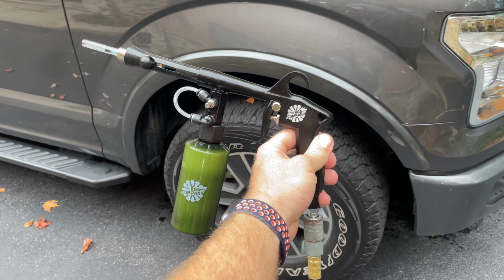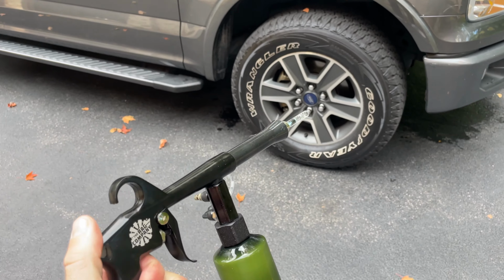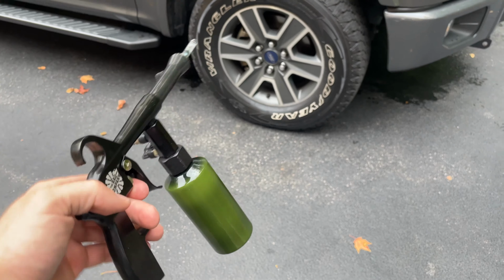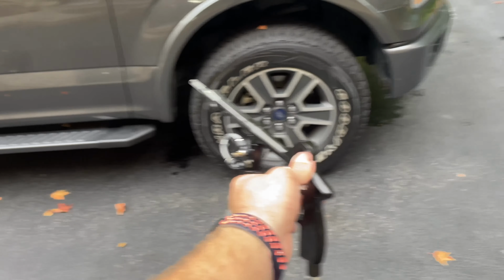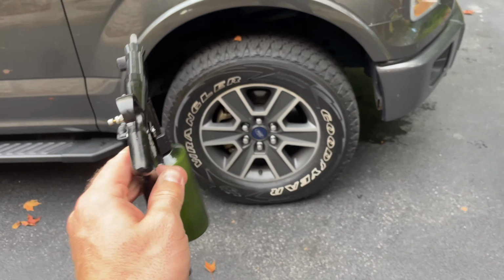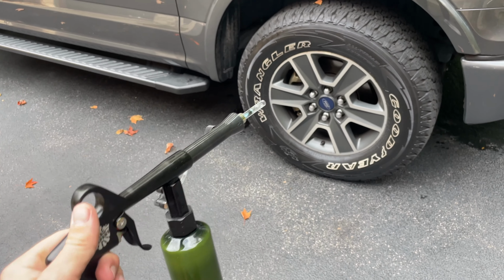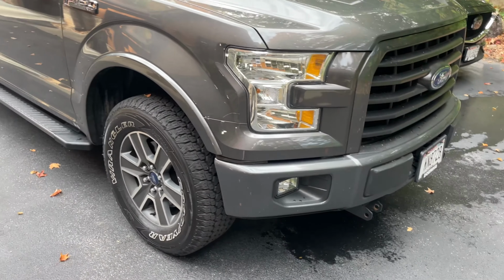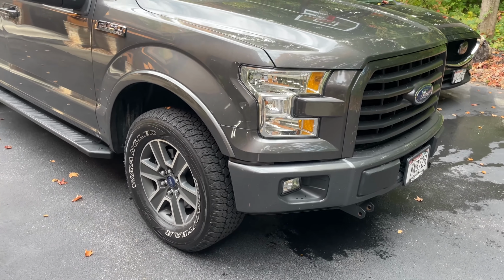All right, so I just kind of wanted to end the video on my final thoughts on this air spray applicator. I'm actually really starting to like it. At first I thought it didn't work, but I just had the exterior shine mixed too thick, so I'm using a 2-to-1 ratio. Well, it might be a 4-to-1 ratio with that stuff. So yeah, you just can't have it super thick. It does a really nice job, and I hope you guys enjoyed watching how to effectively detail an engine safely.